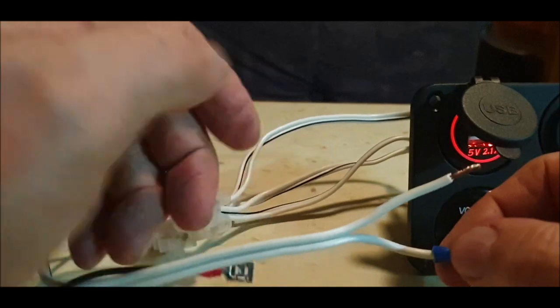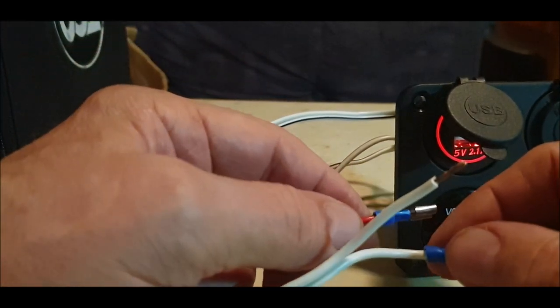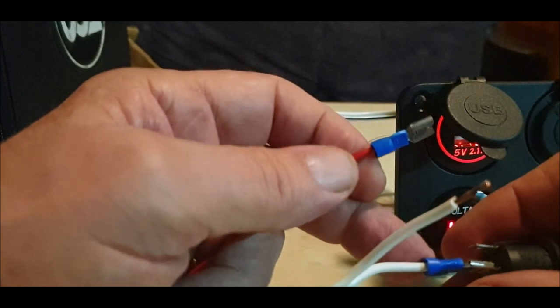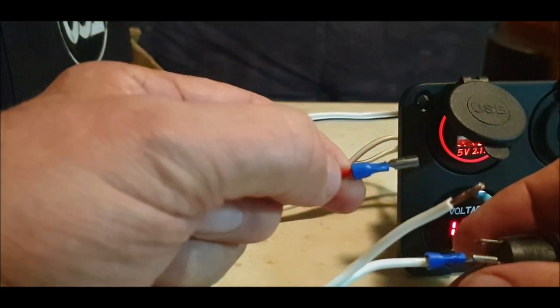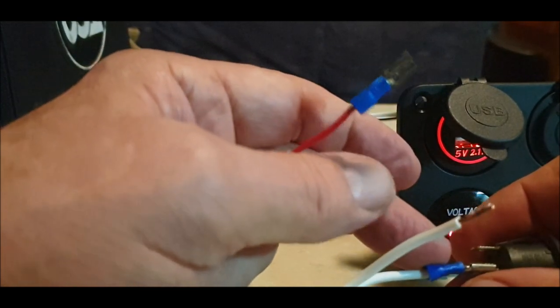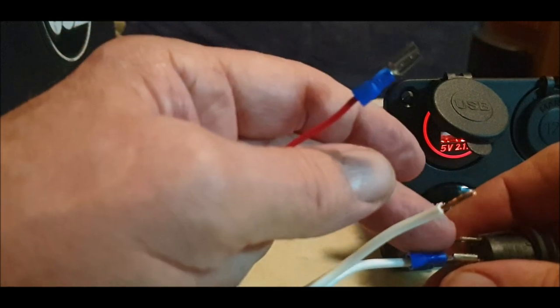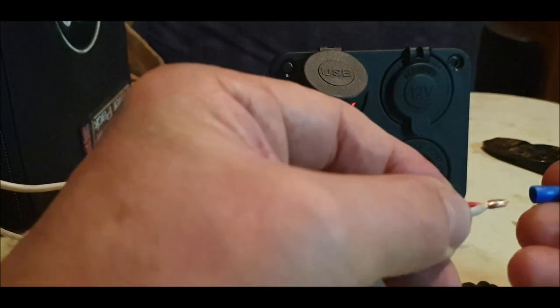the live from the light. I'm sorry, because I'm trying to use this. These lights haven't come yet, so I'm using my light. So I'm going to take the live off the light, and I'm going to join the two wires together, and this will make this side of the light live, and then they'll both be joined, so the light will become live, but it won't be switched until we use the switch, which I'll show you. Okay, so